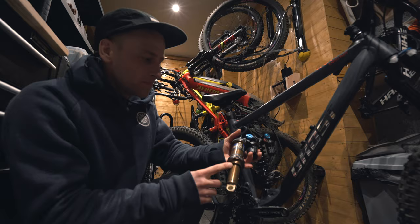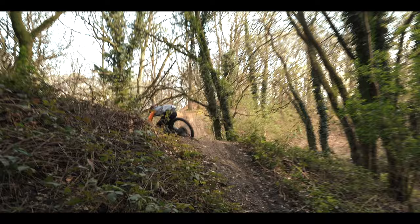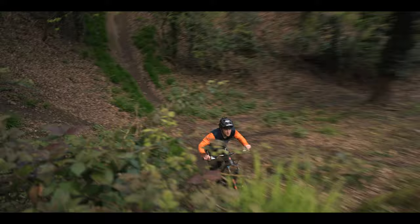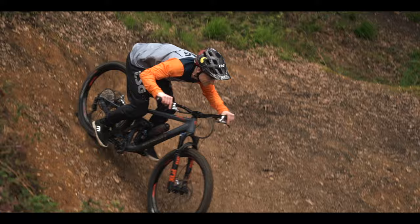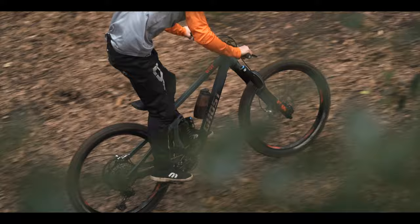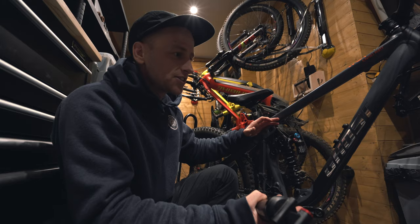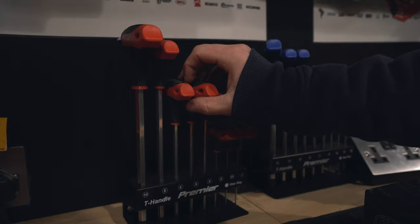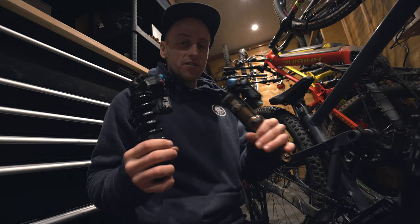This one is gold and is actually gonna look pretty sick on the bike. It's an air shock whereas the current one is a coil. A coil shock is amazing and very smooth — it feels so much nicer — however they're not as adjustable. I want to ride jumps this winter, so with an air shock you can pump it up and get a lot more adjustability, making it basically a lot stiffer, which is what I'm trying to achieve. The coil is smooth and progressive for downhill and tech riding but my local spot mainly has jumps and for tricks this shock should be better. So we'll get this fitted in the workshop and then head to Twisted Oaks.